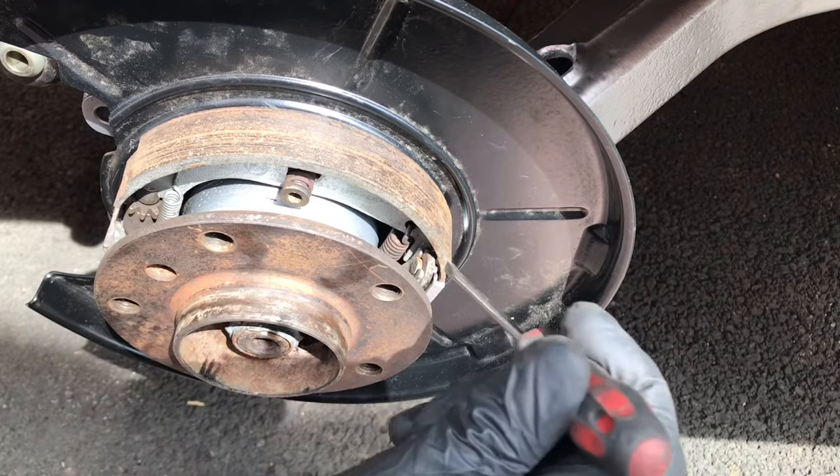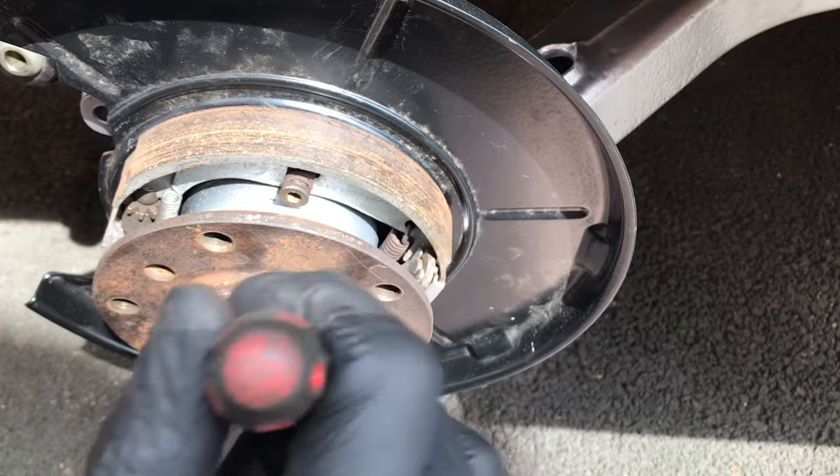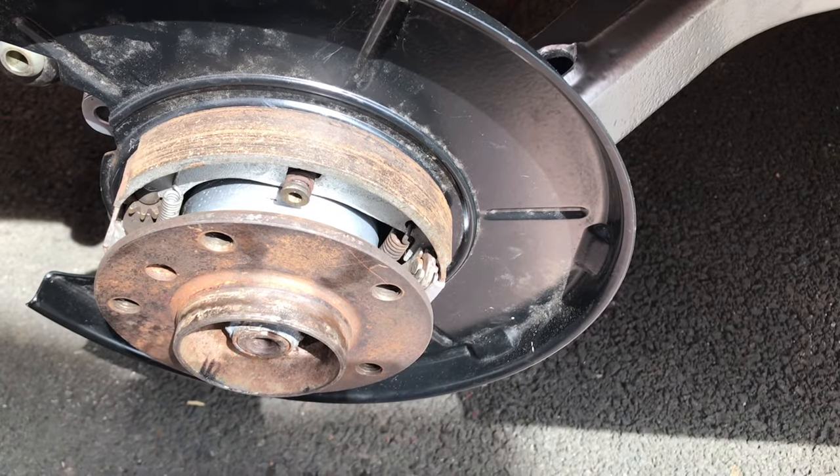Once this end is done, move into the cabin to continue the adjustment on the cabin side, which adjusts the latch mechanism. On the E36 you've got nuts on the end of the handbrake cables, but on BMWs from 2005 onwards you have a self-adjusting locking mechanism that you just release and it clicks into place. Thanks for watching and I'll see you next time.